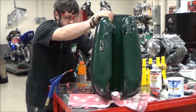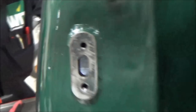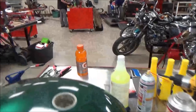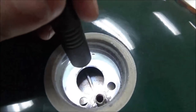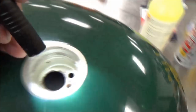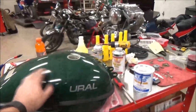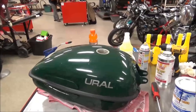I'm going to show you why it's so important to clean out a tank. We've already flushed this a couple of times. If you zoom in here, take a look inside that tank — see all that rust still up inside. A lot of people look and go, 'Oh yeah, looks good.' But that rust on the top side of the tank is going to fall down into the fuel system and create more problems.